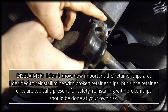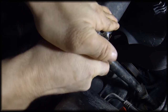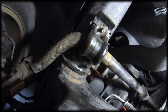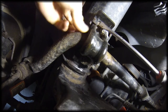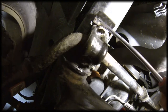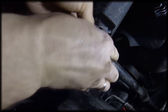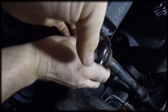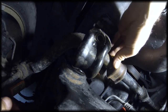Alright, I've got my tab bent up a little bit. I'm going to push the bolts up a little bit and see if we can get this plate out of here. I'm going to bend this one a little bit more. There we go — that should be enough. You don't need to get it all the way out; it's enough to get the sway bar bushing out.